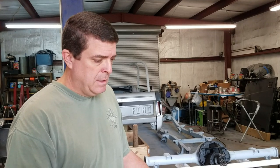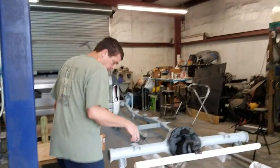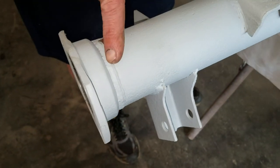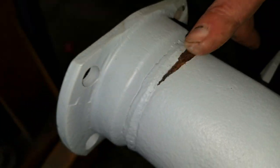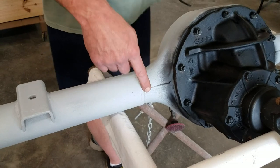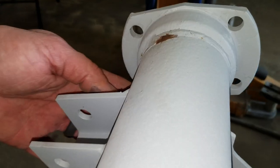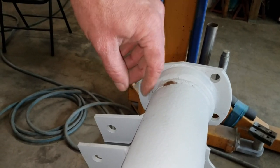The 2K and the metal lock are used as a filler to fill all these little imperfections in the front and rear end. Another thing — Ford was really bad with their welds. You can tell when they welded the end caps on the rear end, it had a long piece of slag that looked like it wasn't even connected. I took a screwdriver and knocked up under the edge of it and sure enough it was just hanging there — just slag where the sandblaster didn't get it. You can also see porosity where the machine lifted.